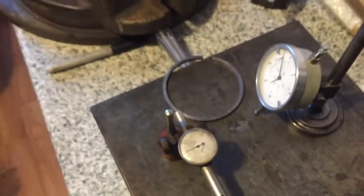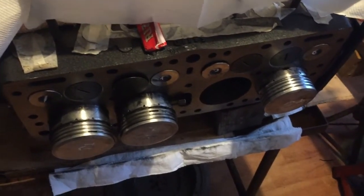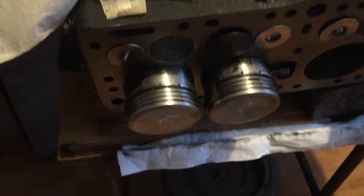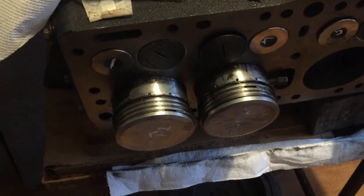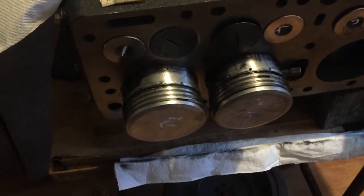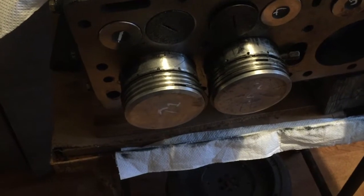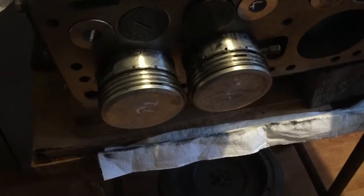So to sum it all up, we still really have to go very carefully even on this homeward run. And of course, this isn't the easiest engine to take rings off and put rings on, because we have to enter the conrods and piston assembly from underneath, because they're pinch bolt pistons, and then push them up through the top of the deck, put the rings on, and then push them back down to connect to the conrod.